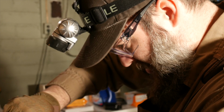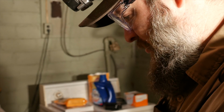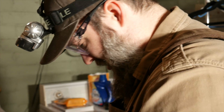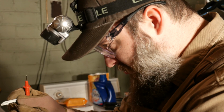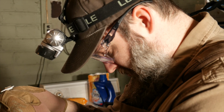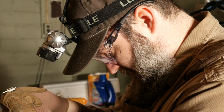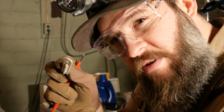Take her knob, turn around to the continuity button, set her down there. We're working, all right. Like I said, take one, put one connection, like so. Put the next one, like so. All right, looks like this here is a problem, so we're going to order another one.